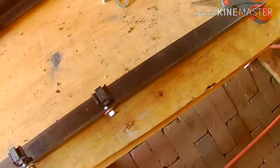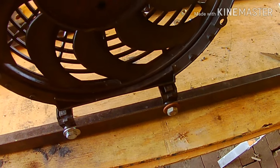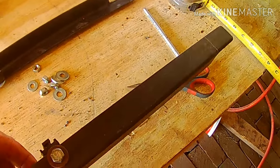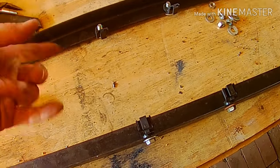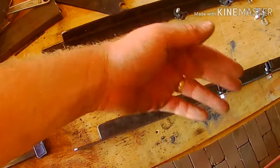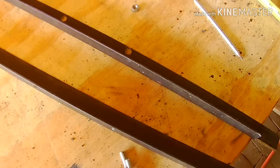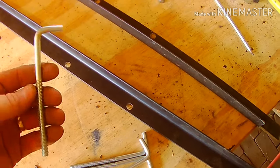We just drilled some holes and took some measurements. We centered our fan on these cross pieces and drilled some holes. These slide from the top down, then rest on the rails going across. I may even make some holes for pins where I can move it as I'm mowing, because when you're mowing the wind blows toward you and you need the fan further up to get more effect. After test fitting this, the fan was way too close to the top of the canopy underneath, so it would not draw as much air as it can put out.